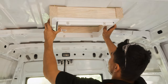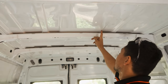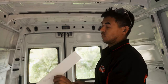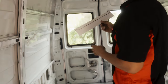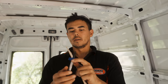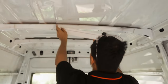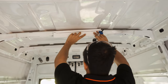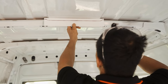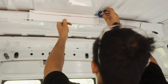This is where the wooden frame is going to go. On the ceiling here there are all these grooves, ridges and valleys. I've cut a bit of board as a template. I'm going to use this on the jigsaw — it's just much neater. I've made a little contraption using a bottle lid and a Sharpie, and I've marked where my bits of timber frame are going to go. This will be my guide and I run my Sharpie along it.